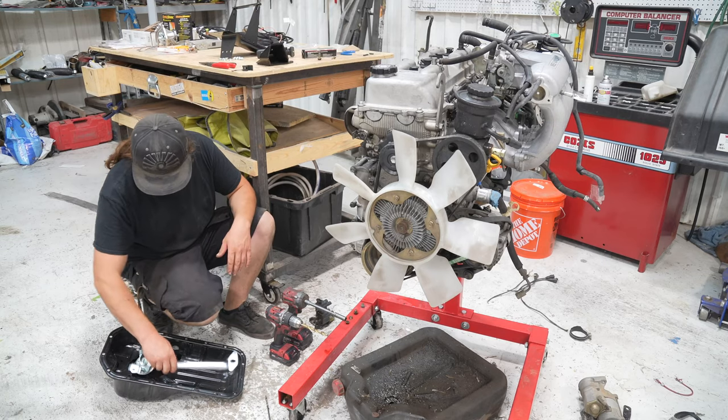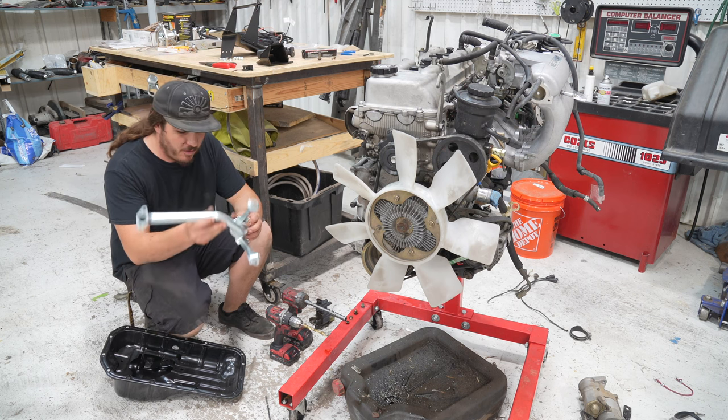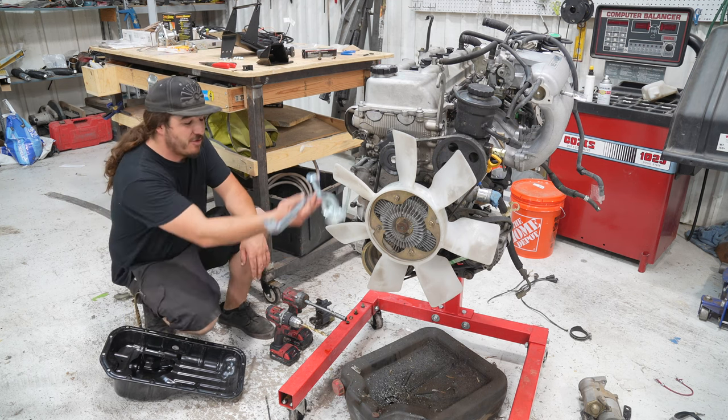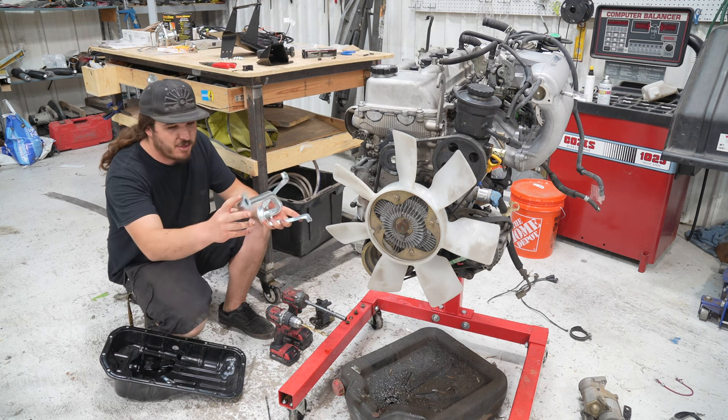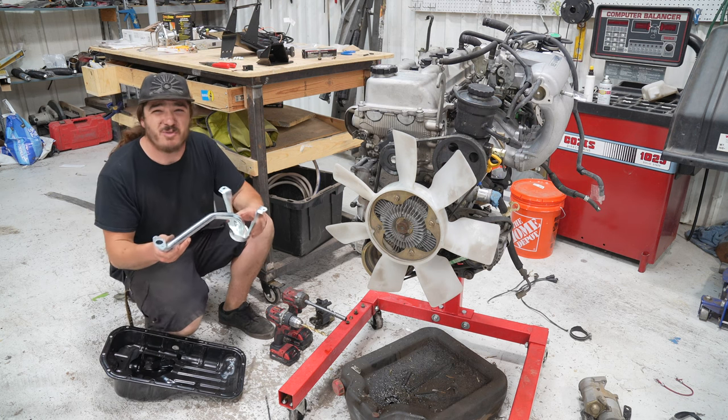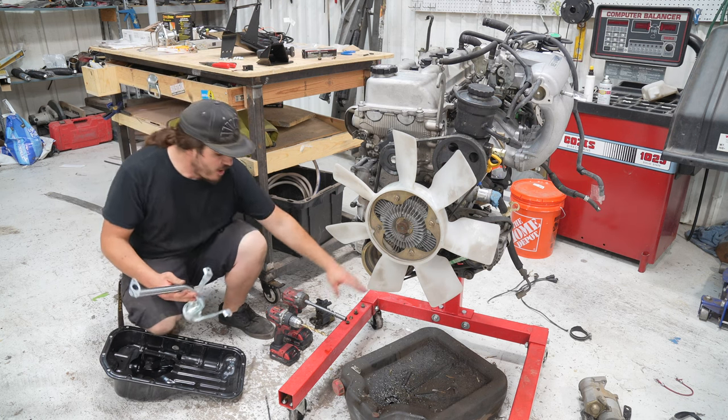We got to get this oil pan on. So this is the rear sump oil pickup tube. So we actually need an extra 12 millimeter bolt because it has two mounting points up there. Only the original bolts here. Off-Road Solutions sent me all of this, including a new gasket, OEM Toyota gasket. So it's gonna be really easy to put on. Got our hardware here.